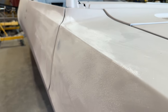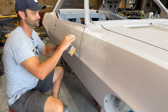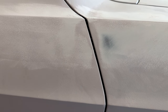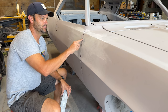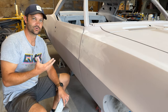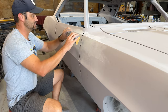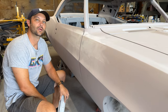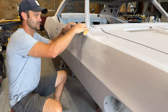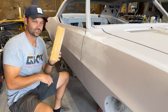What this example shows here before bodywork is done — this is low right here — because see how the sander is not touching it at all. That means on this big flat plane, this is getting sanded. You can tell it's gray. We're even getting into the black primer that these body panels come on when they come out. But we're not touching this pink primer right here because it's just a lower spot. So I think we're going to have to add a little glaze in this area. That's usually what we have to do — just that little glaze to build it up just enough. Then when we go back out over that glaze, we'll have contact all the way across and just keep sanding until we get all the way down to one flat plane. And this line right here — we're not necessarily focusing on it, but it's the product of doing this work. On top, this line will come out laser straight. You'll be able to look all the way down through here and see how it lines up with just a flat piece of block.